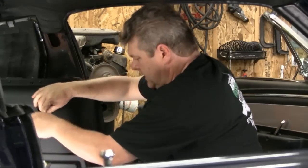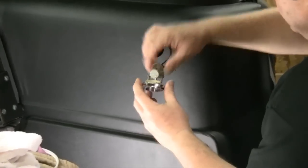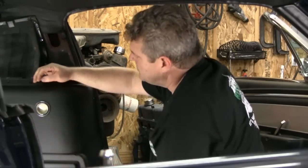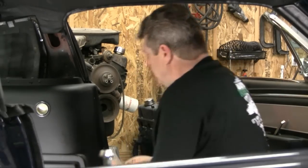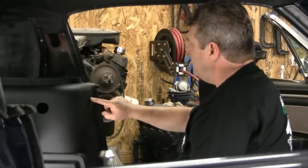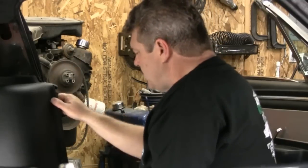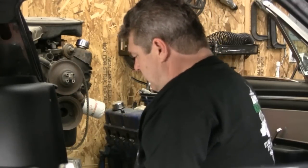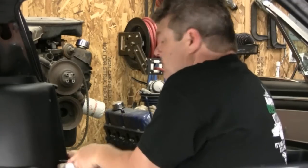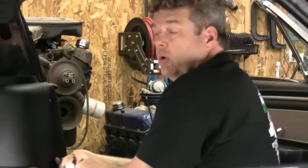You have to have this loose to be able to get to the courtesy light wires, and you don't want to pull this out with the seat forward because you can mar your finish. Put the seat into the full upright position — that will allow you to pull the panel out and fish the wires out through the courtesy light hole. They give you a ton of lead wire most of the time. There is a notch on the courtesy light that goes toward the top of the panel so the light shines down into the back well. Be very careful working on this fiberglass — one problem you can run into is blowing right through it putting these screws in. Don't go super tight, but get them tight enough that everything fits correctly. We used a screw kit from National Parts Depot for the back section.